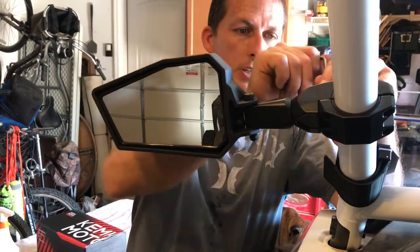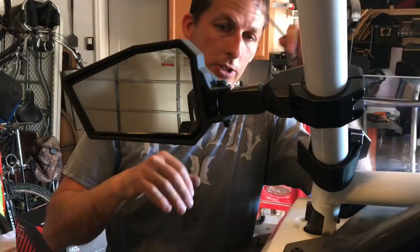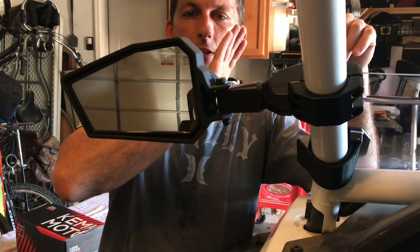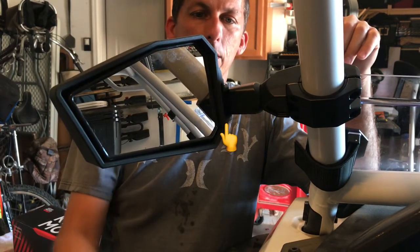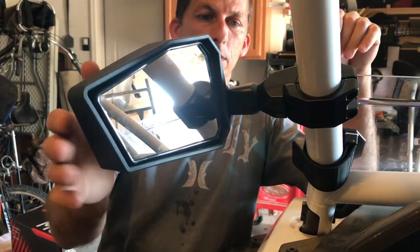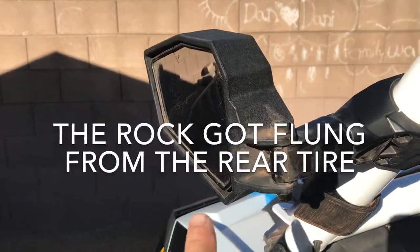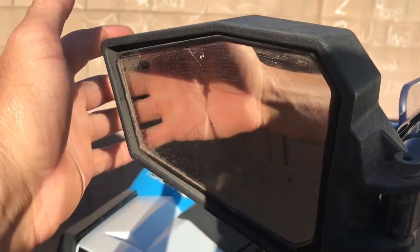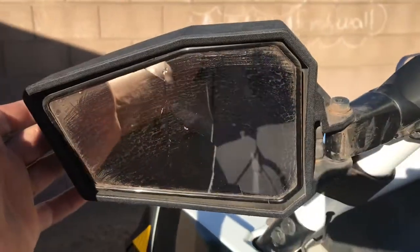It is much easier with two people if that's a possibility. Right now I've got my wife in the driver's seat and we're just adjusting our line of sight. I recommend bringing the tools you installed the mirrors with, plus whatever you need to tighten the breakaway feature — because we went out on the first trail and the mirror was a little too loose, so we had to keep folding the mirror out every couple minutes at high speeds. One bad thing — and I don't think it would matter what kind of mirror I had — I did have a rock come up and shatter my glass. I looked to see if they just sell the lens and it is not sold separately, but it doesn't look like many other UTV side mirrors have that option anyway.